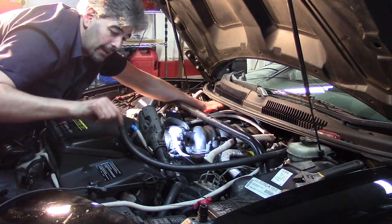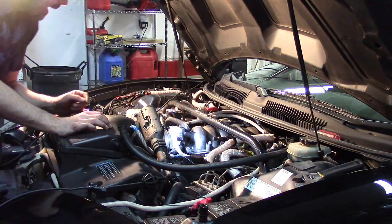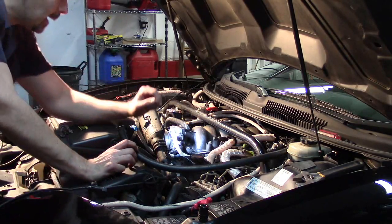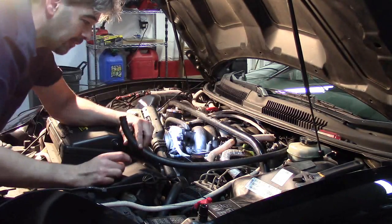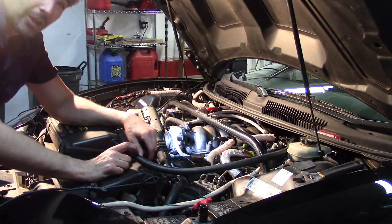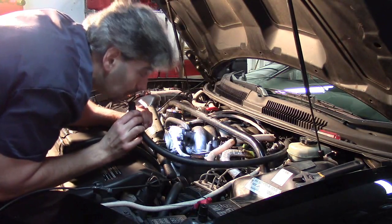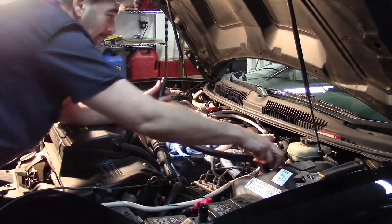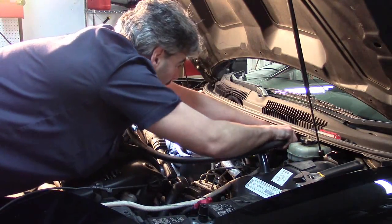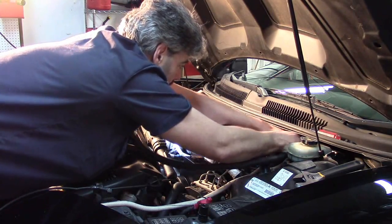By clamping the hose, when I blow air into this hose it can't just bypass the diverter valve and go into the opposite exhaust manifold. I'm blowing on it and — well I blew so hard I blew my hose off, but I put it back on. The idea is that I could not blow through it, so that's good — it means the diverter valve is closed.